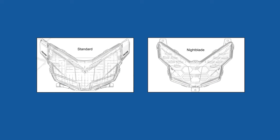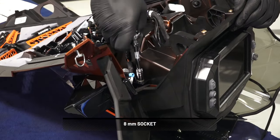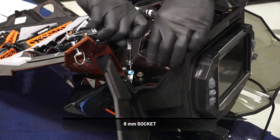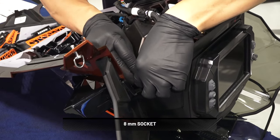Next, identify what type of headlight your vehicle has: standard or night blade. If you have a standard headlight, route the wiring along the left side of the headlight assembly and attach using cable ties. If you have a night blade headlight, attach the grille insert accent light wiring to the hood using the hose clamp and existing headlight mounting screw. Torque to specification.